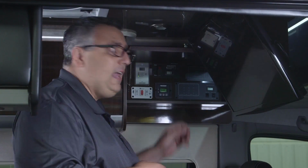One of the biggest questions we get from our customers and dealers is, can I run both heating sources at the same time? The answer is yes. As long as you have the 120 volt source and gas to the unit, you can heat the water with both of those heating sources. The recovery time is much quicker.